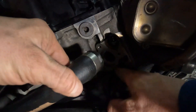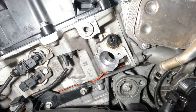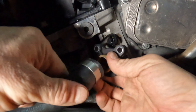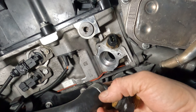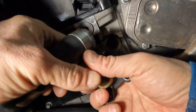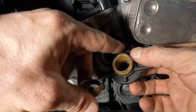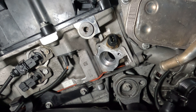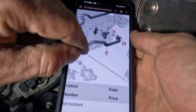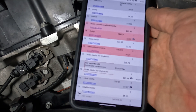What we've got here is this fitting on the cylinder head, which is squeezed in with an o-ring, and a hose connects to it. This is just a piece of plastic with aluminum washers, and when I took this apart it had already been broken — probably by some past maintenance — and was sitting inside the hose. You can't buy this standalone, but you can buy it as part of a replacement for the whole hose going all the way to the thermostat.